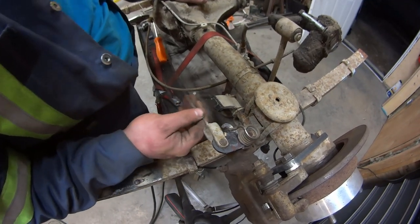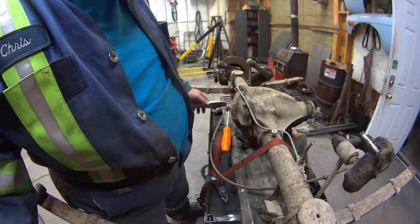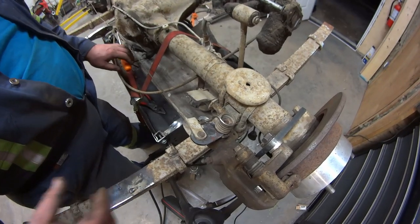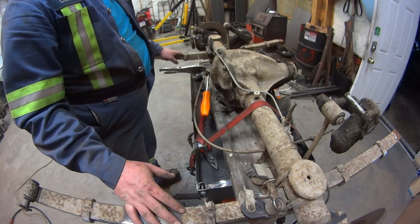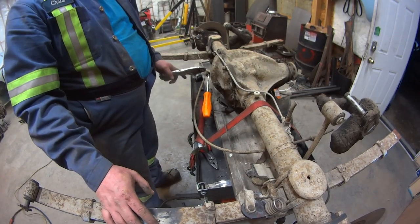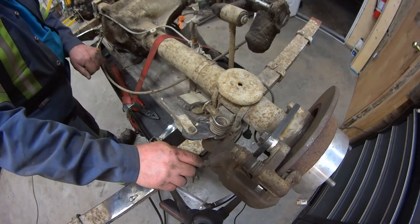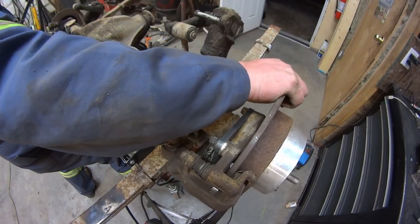You can see here the bracket we welded on there. This is just using the factory cable for now — it'll be shortened, but for now I've just got a vice grip on the other end to keep it to the correct length. Because it's not in the car I have to use a screwdriver to test it. Right up to the calipers we're going to be using all the stock e-brake system, just with modified cable lengths. All we're going to do is take the cable out, trim it down to length, have a new end crimped on it, and we're good to go. When I pull on that, I can't turn the rotor.